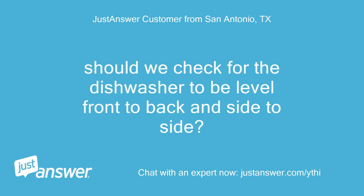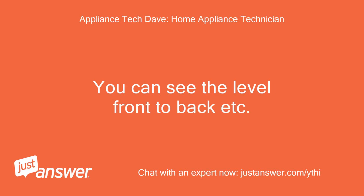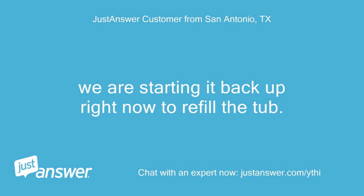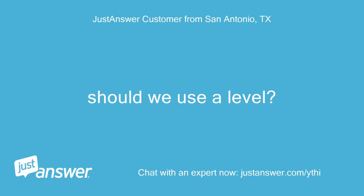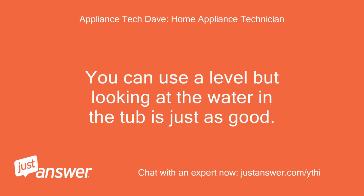Should we check for the dishwasher to be level front to back and side to side? Yes, or in the top of the pump. You can see the level front to back, etc. when the water is in the tub. We are starting it back up right now to refill the tub. Should we use a level, or just by eyesight? You can use a level, but looking at the water in the tub is just as good.